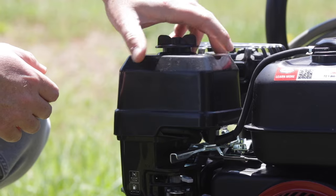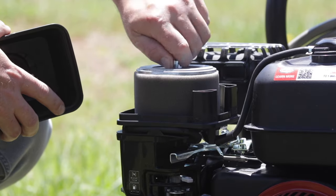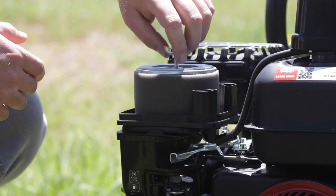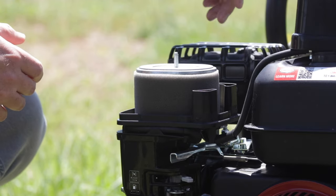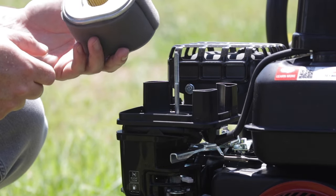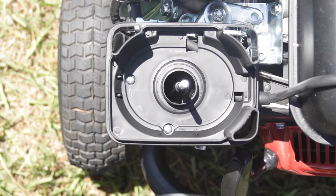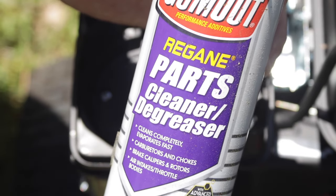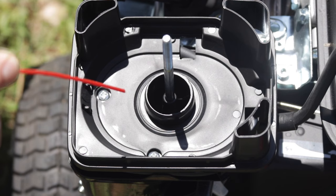Next, you're going to want to find your air filter. Have a look at the filter and make sure it's not covered in dust and dirt — if it is, get a new filter. After that, pop the filter off and take a look down into the carburetor area and make sure there's nothing blocking air from getting in. If you need to, you can grab some carburetor cleaner or parts cleaner and spray it in there to make sure everything is cleaned off.